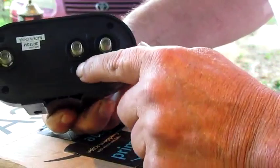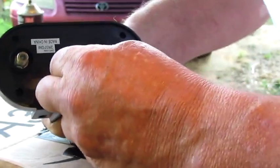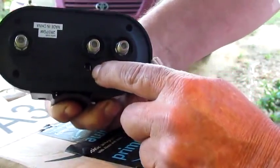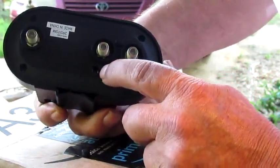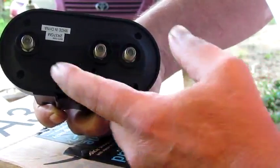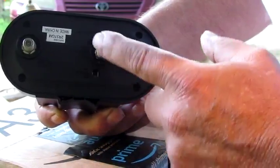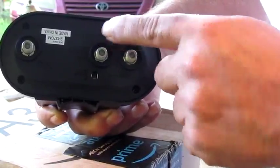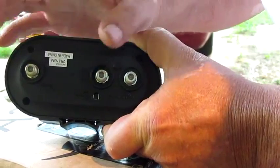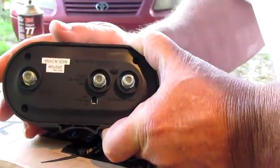On this booster, they've got two little rubber stoppers that go in here. When you get these boosters, take that rubber off — there's a little switch inside of there. This booster comes set to run common, and that means just a one-wire antenna. So you would be using these if your antenna just had one wire coming down from the antenna.